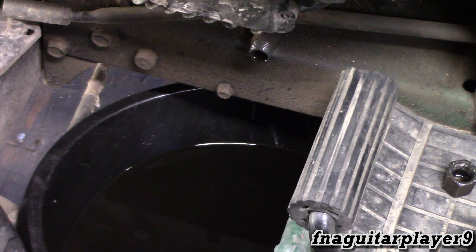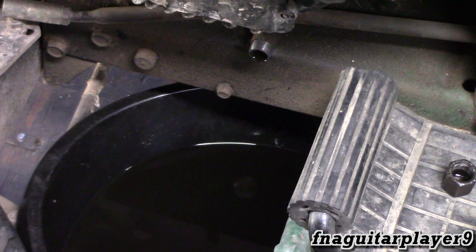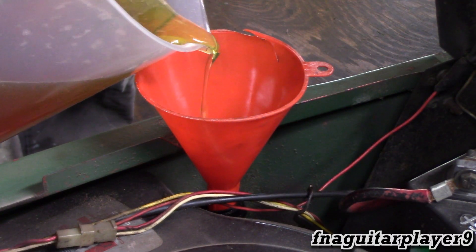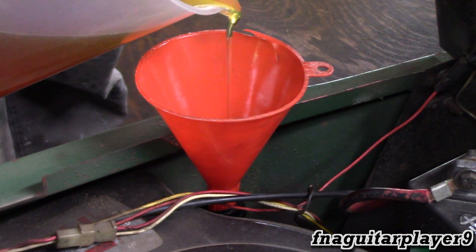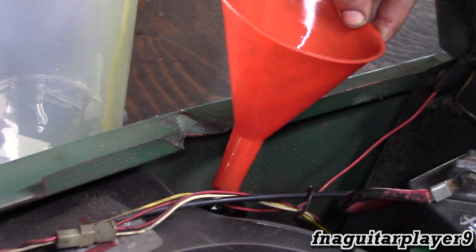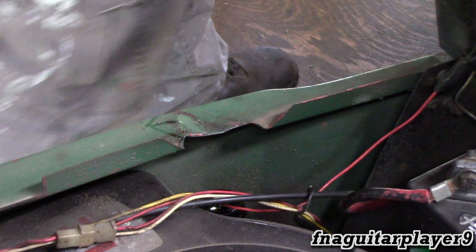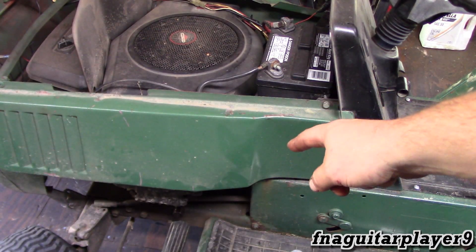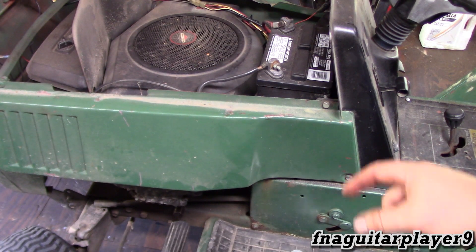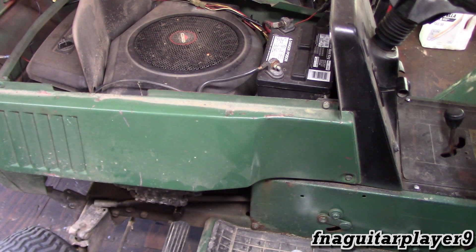Take a clean rag and put it over the measuring cup until you're ready to use it. We've still got a pretty steady drip from the oil, so we'll let it drain — I may jack up the other side of the motor just a little bit to help it drain. Now the oil plug's back in, so we're ready to add the fresh oil. Since we measured it, we don't have to keep stopping and checking — we just pour it all in knowing it's the right amount, but we'll still check it after. It's right on full. If your engine has an oil filter, make sure the rubber ring comes off it. Run it for a little bit, then check it again.